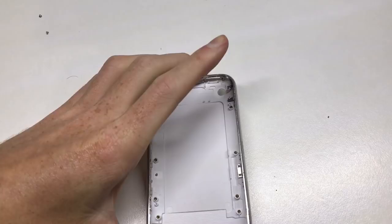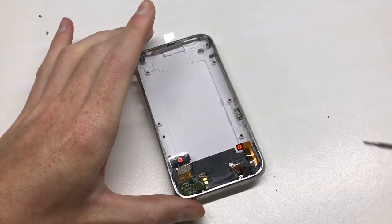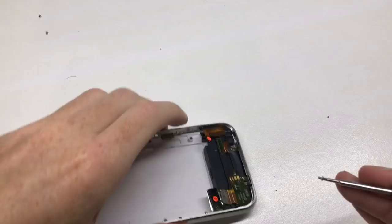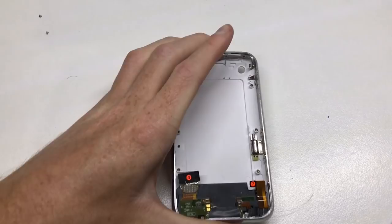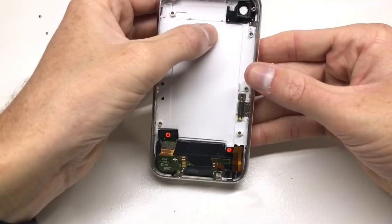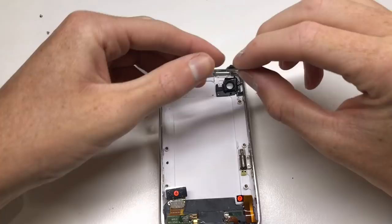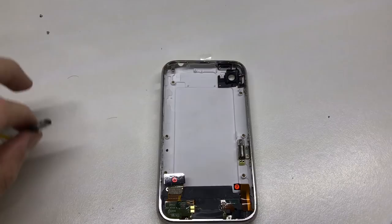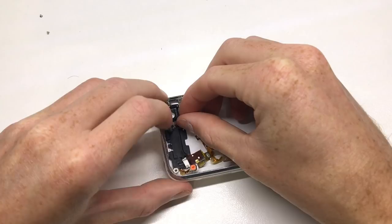Here's the new housing — very clean compared to the old one — but you have to transfer literally everything from the old one: the camera bracket, headphone jack metal insert, speaker grills (which I couldn't get out, so I'll purchase those separately), the metal bezel, power button, volume controls, dock connector, vibrate motor, and even the tiny SIM card eject piece of plastic. Everything has to be transferred over, so it's quite an involved job. The entire process took me about an hour.